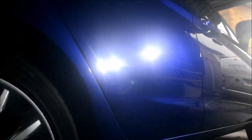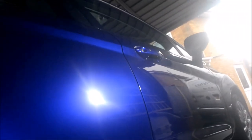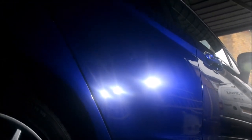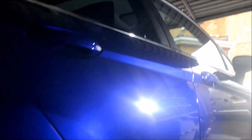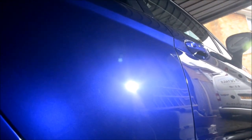On final inspection, we can clearly see the capabilities of the finishing polish and pad combination are quite impressive. This wasn't a paint correction, so if there are any deeper scratches, they will be dulled down but not fully removed. The aim is to remove the bulk of swirling and present a much glossier, sharper and truer colour whilst providing the perfectly clean base for ceramic coating to bond to, which is going to be covered in episode 4 of the Blue Fiesta.